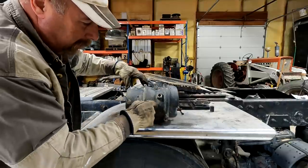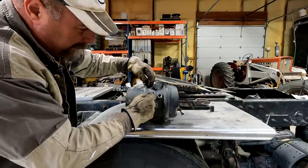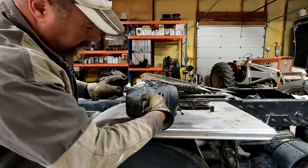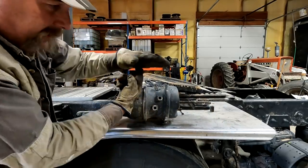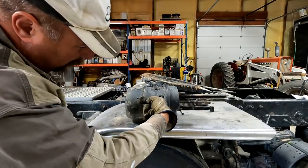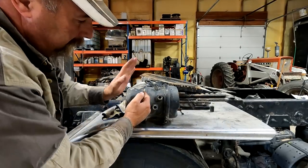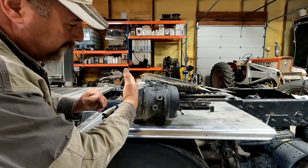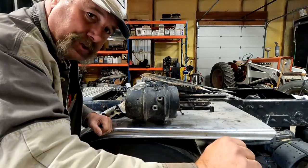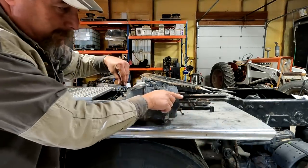What happens is when the air comes into this air hose comes into here, this chamber, it builds air pressure up and pushes that diaphragm over. This rod comes over, and there's a plate welded to the end of it. Think of it like a great big head nail, okay? The shaft comes all the way up to here, and there's a big plate, all right? So the diaphragm pushes that plate and compresses this spring. So when you push the brakes in on the dash to release the park brakes, this airs up, compresses this spring, which pulls that rod back, okay?